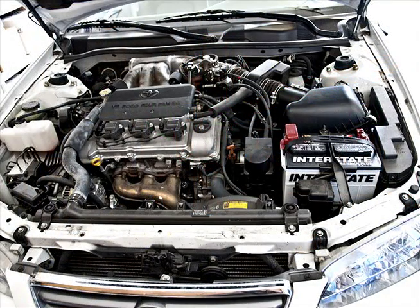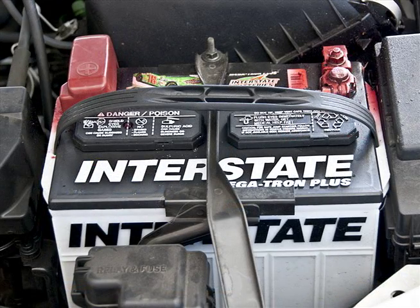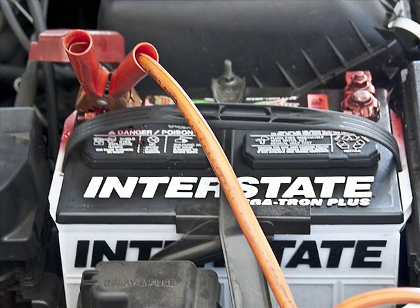This is the engine compartment of our boosting vehicle. You'll see the battery on the lower right. I'm not going to cover up the vent holes in order to keep the illustration simpler, but we next connect the positive booster cable to the positive terminal of the booster battery. Be absolutely certain it's the positive terminal, because if you cross terminals, you can cause a lot of damage.